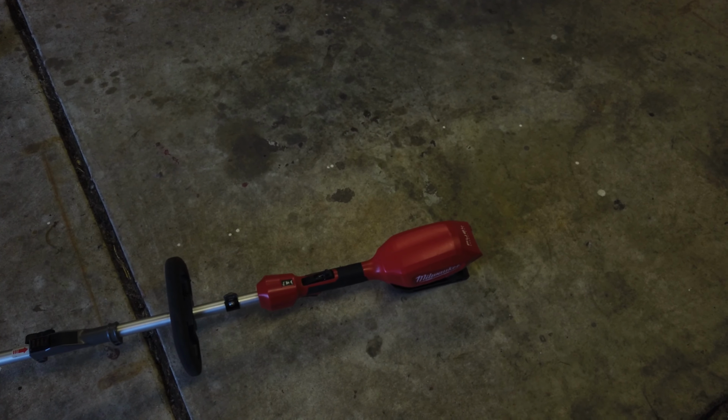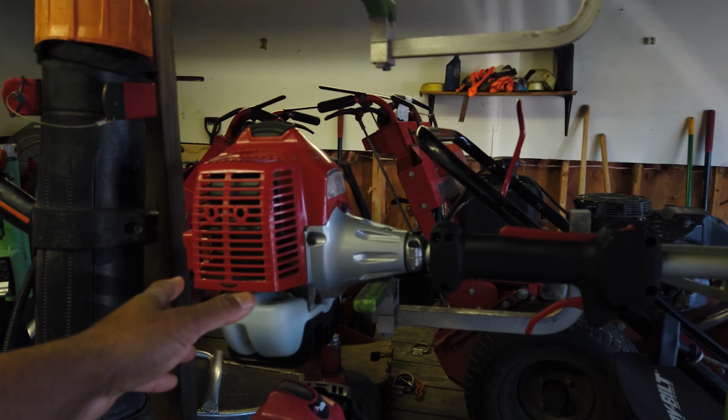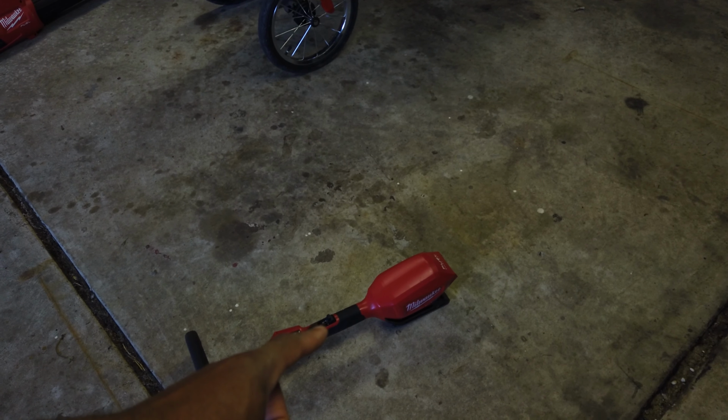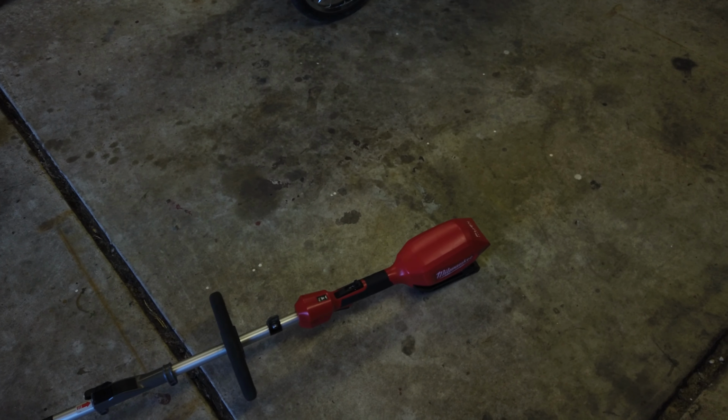Then you've got this big heavy 12 amp hour battery hanging on this thing, and if you put it on one of these racks and it's bouncing down the road, that battery was never intended to bounce up and down. The last thing you want is one of those batteries to pop off because it's hanging off on the rack.